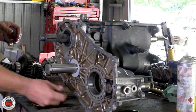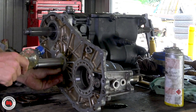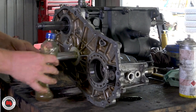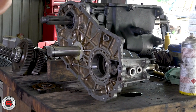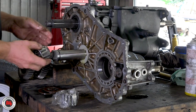Looks like there's a keyway there. Really important to get this right - otherwise you'll crush the keyway and they'll just start spinning in there, causing premature failure of the thrust washer. At the end of the day, a thrust washer is just a spacer - to hold the cogs, or in this case the needle rollers that are inside the transfer gear. So if they can move, they can wear too fast.